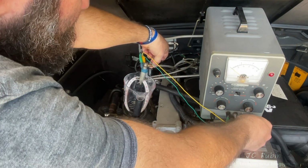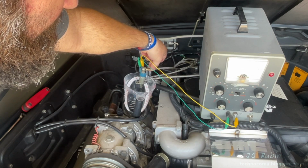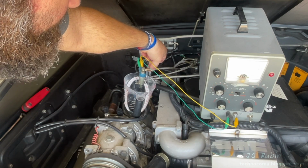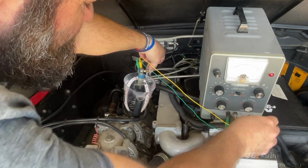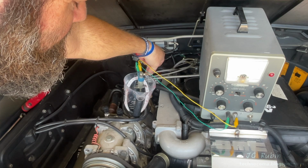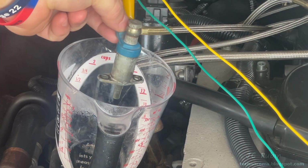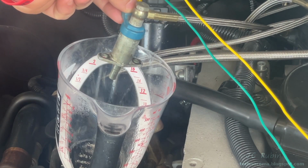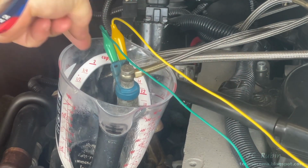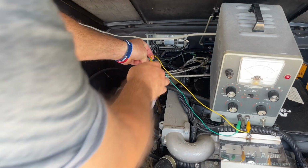I'll lift up the injector so we can see, and there we go, a mist of gasoline, which is very dangerous, doing this with a lot of fresh air and ventilation, where it dissipates in the air. Again, and we can see a nice cloud of gasoline. We definitely wouldn't want that to ignite. I'll do a couple of quick close-ups, and then I'll let this place ventilate. Remember, atomized gas is dangerous. The battery is not connected on this car. The pattern looks great. Our test is completed.